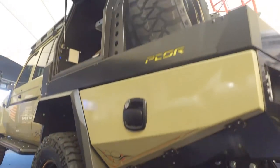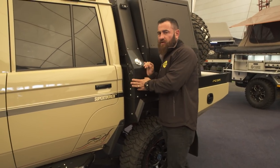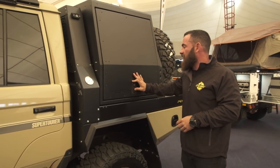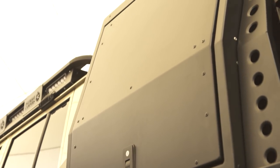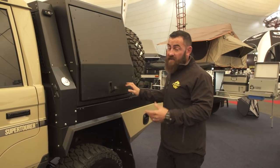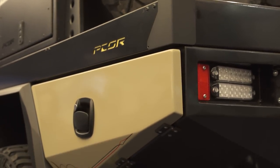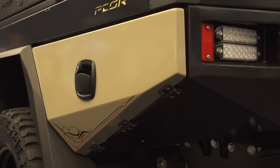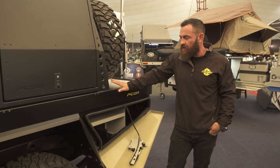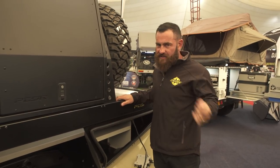This is the same tray we have on the Ranger, obviously modified for the 79. You can see we've purposely kept the width at 1800mm wide, which really suits the boxy shape of the 79. On here we've got a Pecor half canopy — you can fit a fridge slide in here. An MSA fridge slide will take up to a 65-litre Dometic Waeco fridge in the side. You've got central locking toolboxes, same as all the new Pecor range. The tray is all aluminium and will come in somewhere around 250 kilos, which does wonders for your GVM.